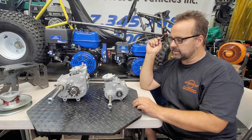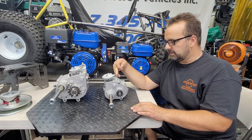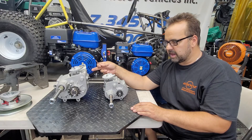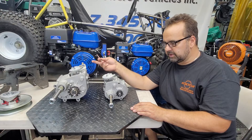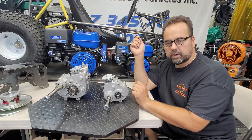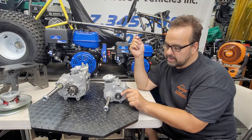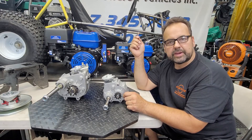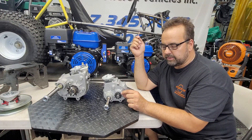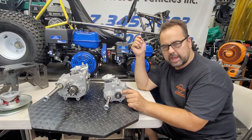The two gearboxes are physically quite different. The 30-series weighs around seven pounds; the 40-series weighs around 15 pounds — basically twice as heavy. Both typically come with a 35 or 41/420-series sprocket. You can remove the C-clip and swap sprockets for whatever drive system you're running. The 35 chain comes with a 12-tooth sprocket and the 40-series with a 10-tooth.